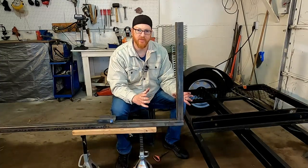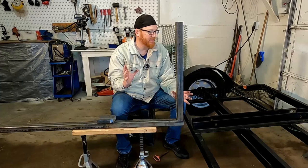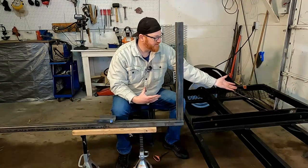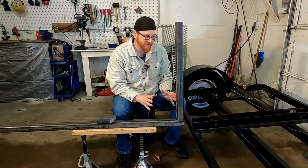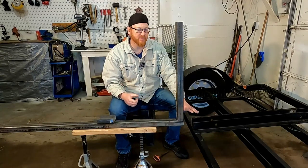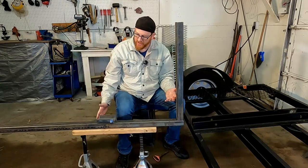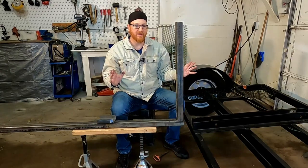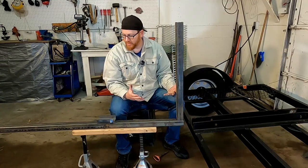I'd really like to be able to actuate this with a hydraulic or maybe some kind of ratcheting draw, but I'm having a hard time visualizing the mechanics of bringing this from here to here. This may be a version 1.0 and I may have to redo it — 170 pounds is too much to lift, especially on a higher receiver. We'll have some bracing here, then I'll cut the two inch receiver to length after I have all my other measurements and can see the play of the trailer.